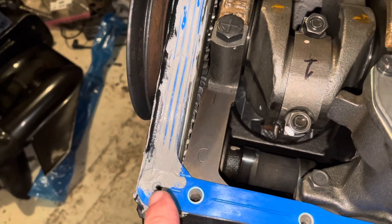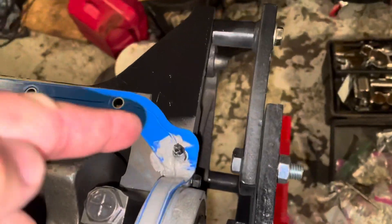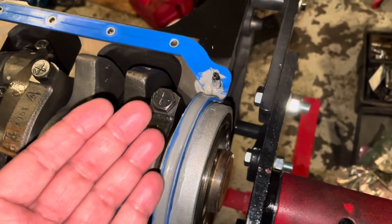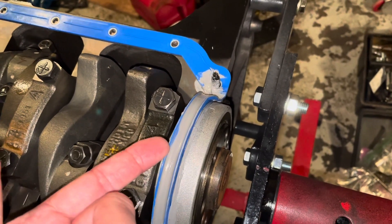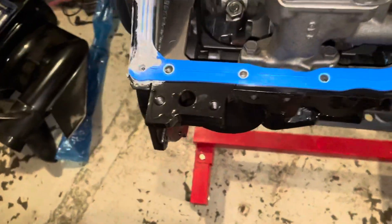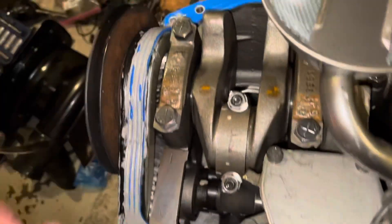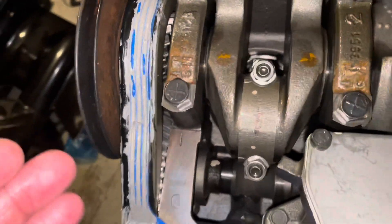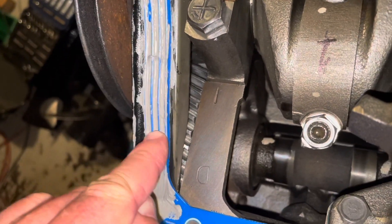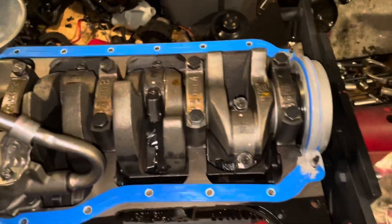I'm using Ultra Gray silicone sealant. I put it in the corners both underneath and on top of the gasket, smeared across the top, and the same thing on the back — top and bottom in the corners. The reason I put it at the low points is because if oil is going to come out, it'll come out at the low points. This end is upside down, so these corners are the low points. The sealant also acts kind of like a glue. This gasket has little rubber nubs that fit inside the holes — it's tricky to get them all in at once, but be careful not to squish a nub underneath instead of getting it into the hole. Now I'm going to set the oil pan on top of the gasket and start fastening everything down.